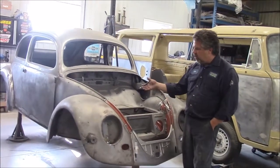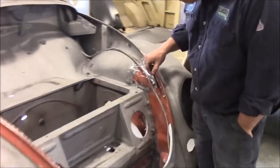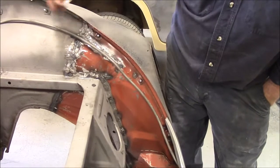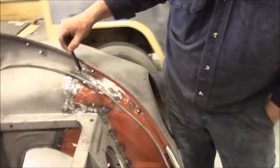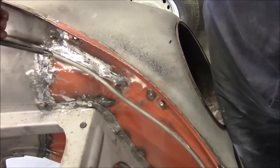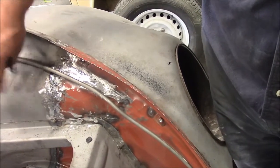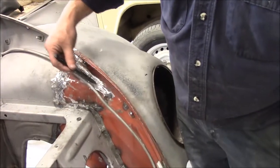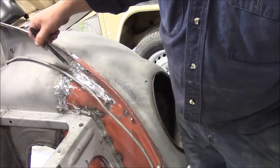In terms of the nose section, it's coming along really well. In this section here, we basically had to modify — and it's very common to take an aftermarket panel and modify it to fit our application. You can see where we have the shiny metal, this triangular piece that's welded and ground smooth. That was a piece we had to weld in. When we were working it — heating it to shape and using hammer and dolly to match the original metal of the car — it didn't have the bend or the shape required, so we had to notch and modify it to fit. That triangular piece is actually a piece of metal that we made here.